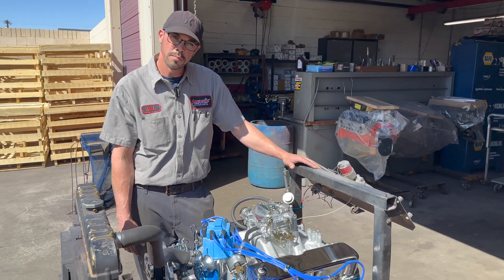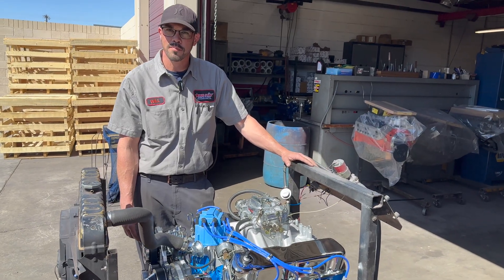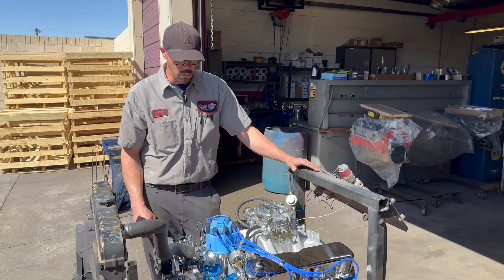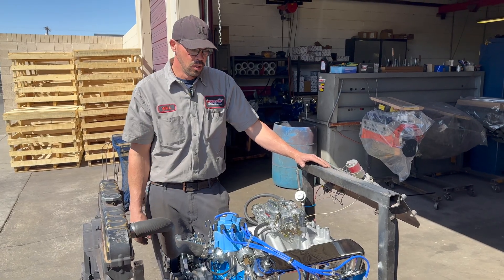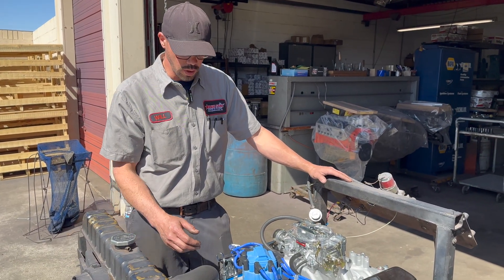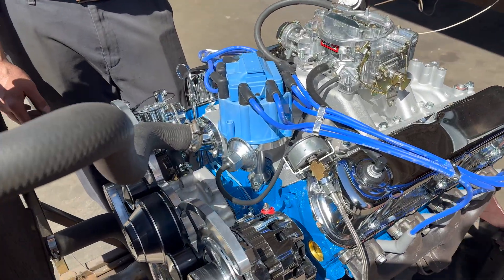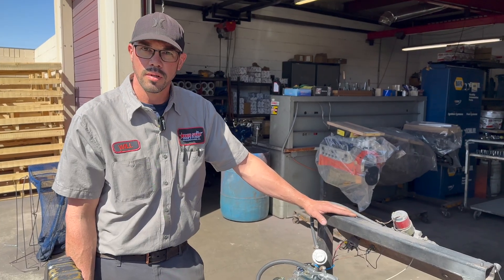As long as we're looking at Fords and modifications, what kind of stroker options are there on these blocks? The most common one on the Windsors is a 408. We have another local customer who purchased a 408 from us — we source all the parts, get the crankshaft and connecting rods, balance it, and build out a crate engine. Generally on the 408s we put aluminum heads on it to give it a little more power — those come in close to 500 horsepower depending on how they option out the cam.